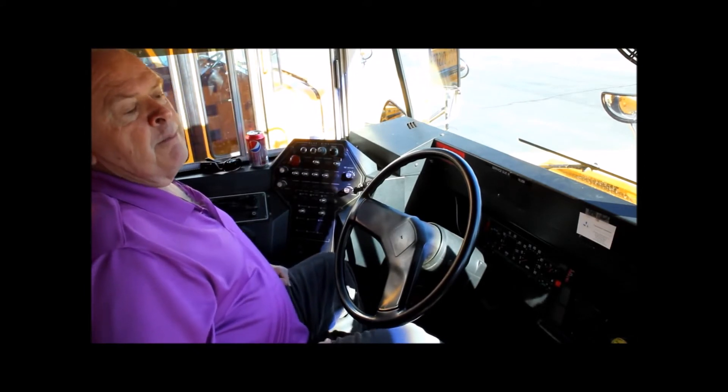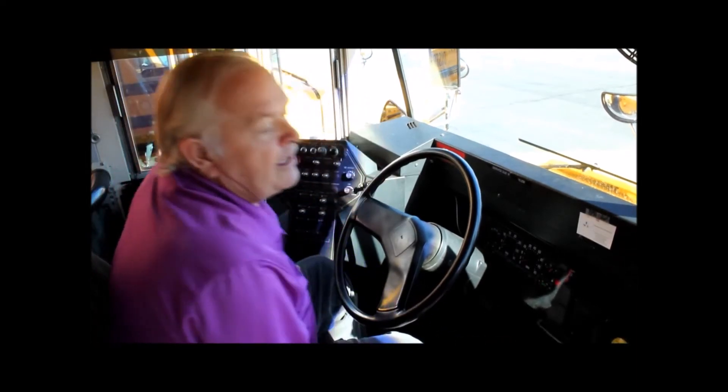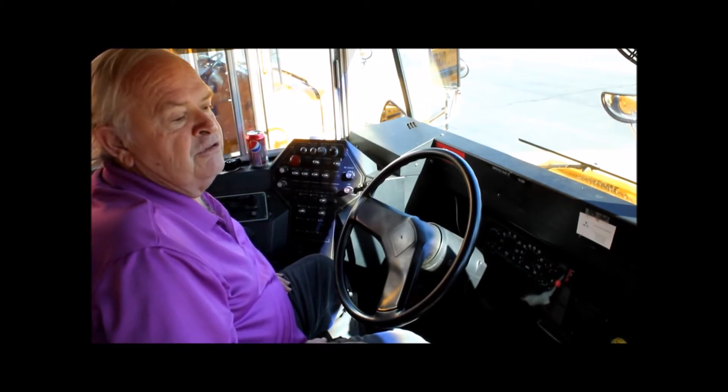There's the hum from our power boost. Holding down and starting the vehicle, the pedal did move closer towards the floor. This shows that our power boost is working properly.